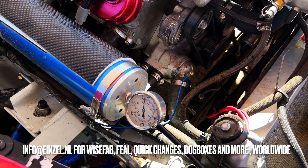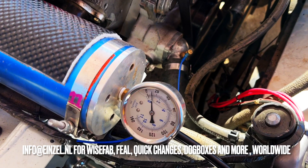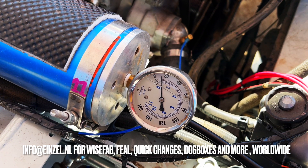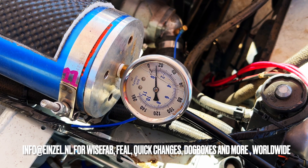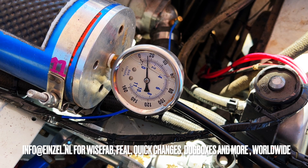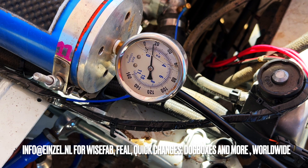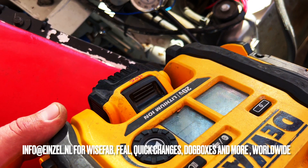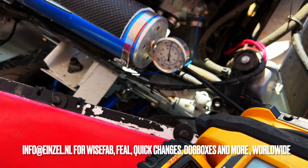Then you air it down to anywhere between 10 and 15 psi — this depends on what oil pressure your motor makes and the application. We like to be around 10 psi because the back pressure on the air side, the side with this gauge, determines how far that blue canister will fill. It never fills up all the way, but obviously you want as much oil and air as possible. However, if the engine loses oil pressure, being on lower psi also pushes the oil back slower into the motor, so you don't want to go too low but certainly not too high.